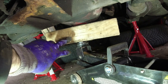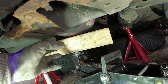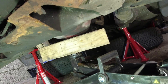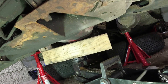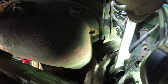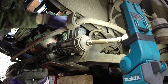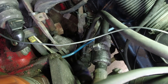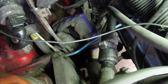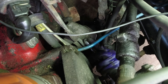We've got a jack with a bit of wood on the bottom of the sump, because it's quite a round sump so it's not that easy to lift from - I'm just on the sump plug. That nut there is obviously what we've got to remove, so I'm going to start with this side. I'm also going to have to remove this bracket here - these are probably 12mm.